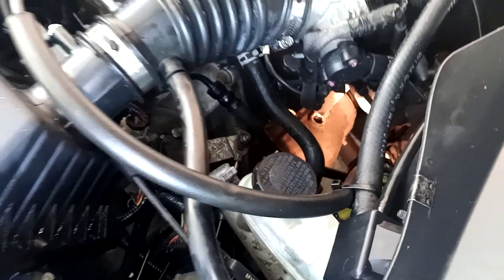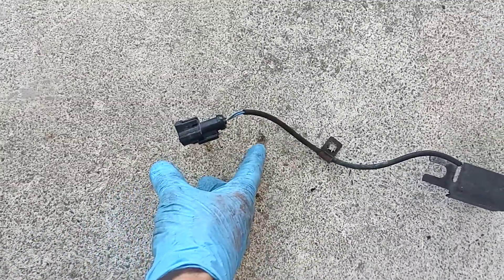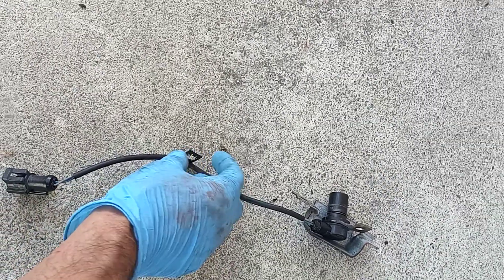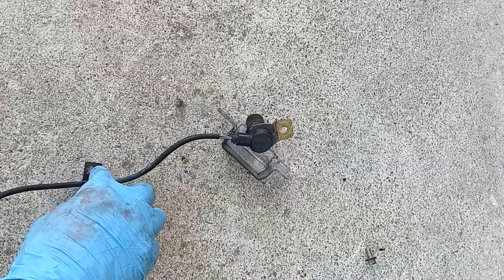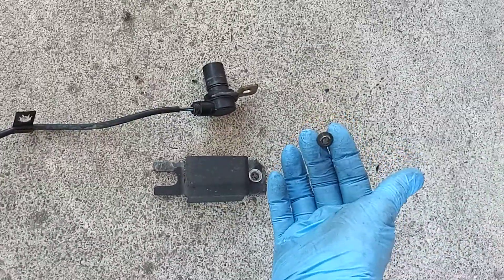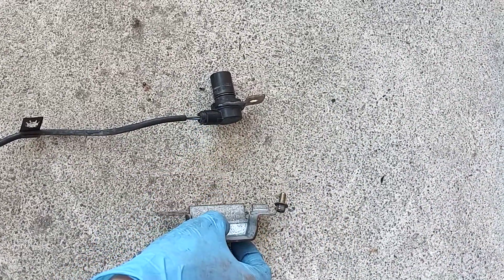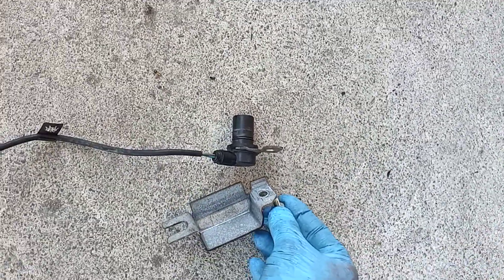It's a little difficult to get to. Here's what it's going to look like more or less from the top. You have the electrical bracket, and this little tab that doesn't require a bolt — it just gets held down inside there. You have this protective shield on the top, and a bolt — at least on mine it's an 8mm — that goes through the top and through the bracket and holds all of this down.